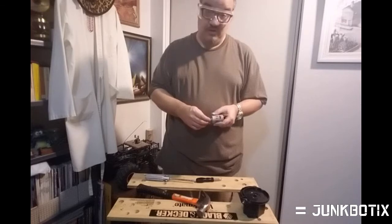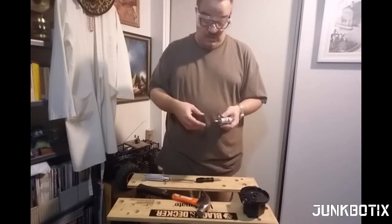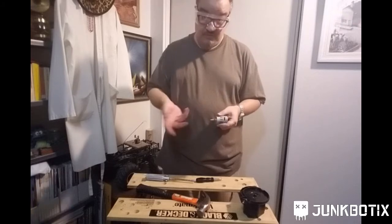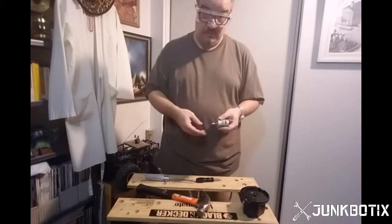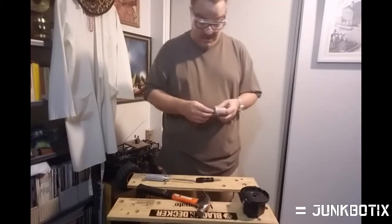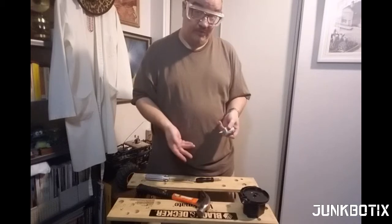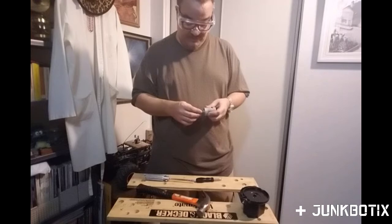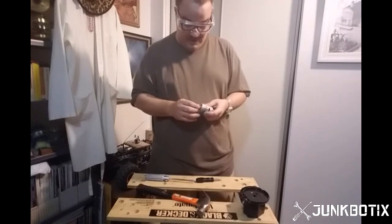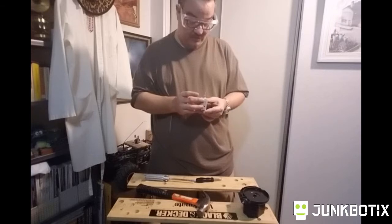If you use an H-bridge or some other kind of motor controller, you want to size that motor controller for the stall current, ultimately. Otherwise, you'll burn the motor controller out if the motor stalls. Or at least it should have some kind of overload protection to protect it from any inadvertent stalls of the motor. But yeah, that's what we got here. We've got a very nice motor.